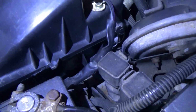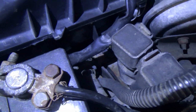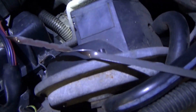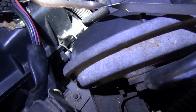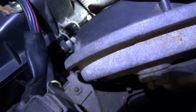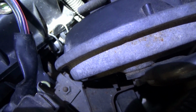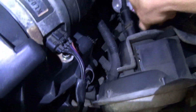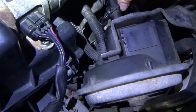We're checking the transmission fluid level. It's definitely high, maybe too high. It should be down here with the engine idling. It's like all the way up here, not down here. So it looks very clean. So I assume this car has been serviced. Now, I don't know if it was serviced by a qualified technician. I see some new hoses. It looks like a transmission cooler, zip tied to there.